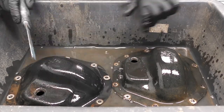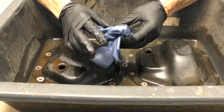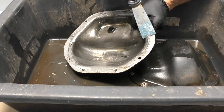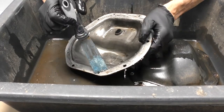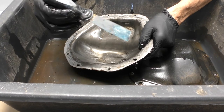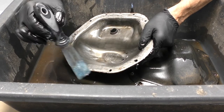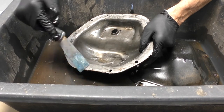I'm going to leave that to soak. I've left this overnight and it's been soaking in a stinky old de-greaser, which will hopefully have softened some of this up. This is the one with the majority of the sealant still on - that's more like it. The only reason I'm doing this is that if you sandblast, everything you take off ends up going back through - unless you've got sophisticated equipment, which I haven't. All the rubbish, rust and crud gets blasted back through, so you end up blasting with a medium that won't do anything - you're effectively blasting with old gasket material or paint. So getting as much off as possible is best practice, so I'm told.